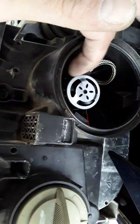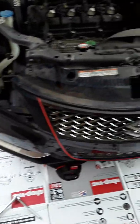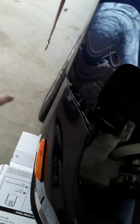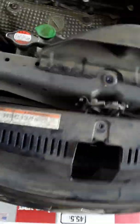It's got a little clip and all this for the H1 or whatever headlights they usually use. And it's just impossible to get to because it's underneath this beam and everything. So you do have to take the bumper loose. I saw one guy took the whole thing off, but you don't have to. You take some bolts loose on top.